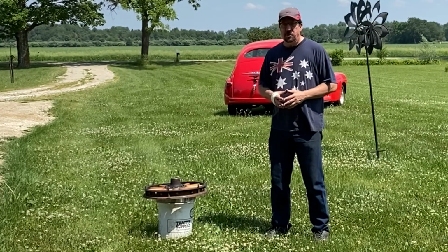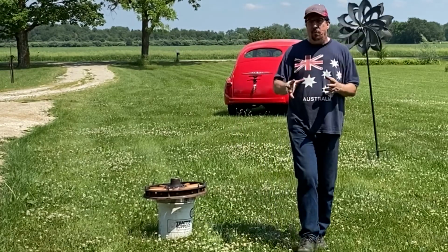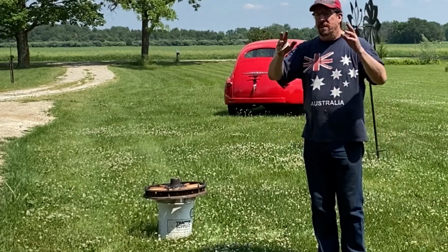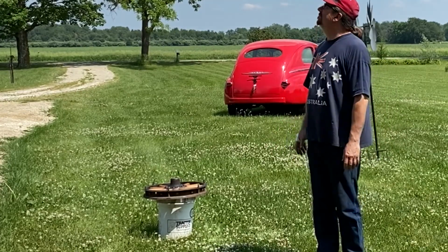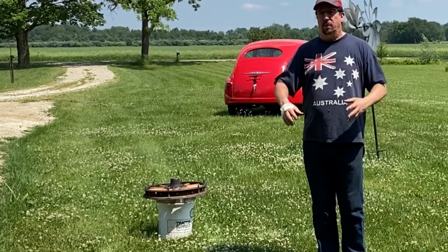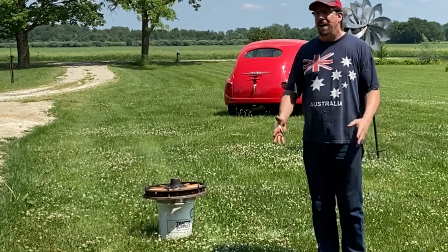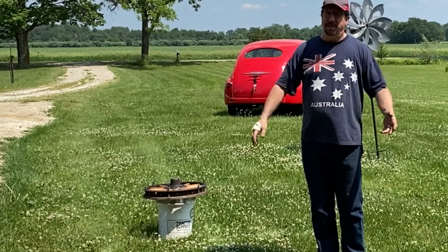One other thing that I did want to mention, at least on the Model T, but I know it's true of everything in this vintage: if you have wooden spokes that are loose but not rotted, in other words, the wood is just dried up a little bit and they're a little bit loose, Ford Motor Company's recommendation is to drive your car in the creek and let the water from the creek swell the spokes back up. So, you know, it was a different time, definitely. But that's very common on a lot of these old wheels: if they're really dry, as long as they're not dry rot, as long as there's nothing wrong with them, you can put moisture back in them just by soaking them in water.